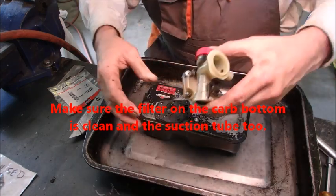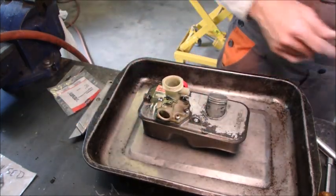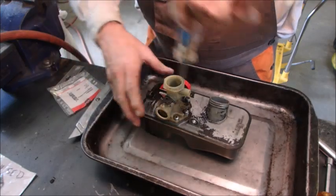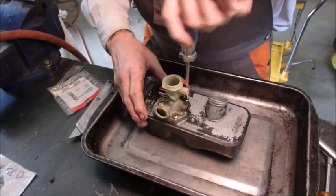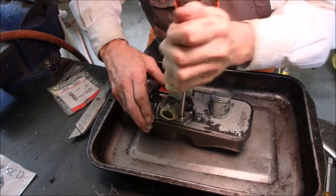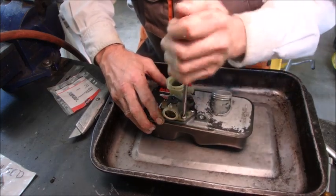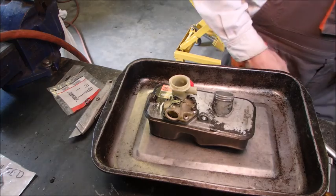I've got the 5 screws in already. You can do this similarly many different ways, right? And the screws actually line everything up. Okay, let's screw this down. Crisscross pattern, of course, as much as you can. 1, 2. Not tight, just firm. Good. Now that can actually go right back on the machine.